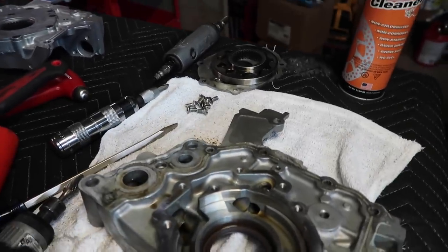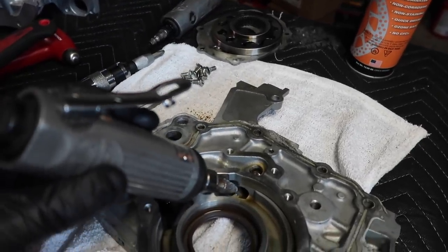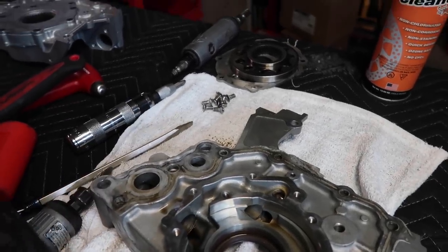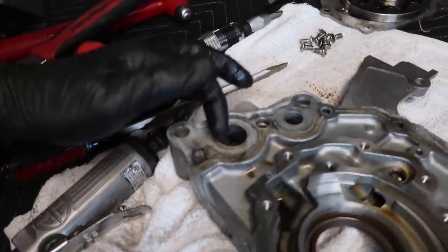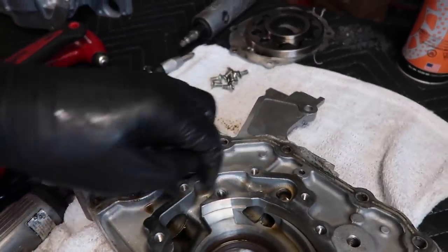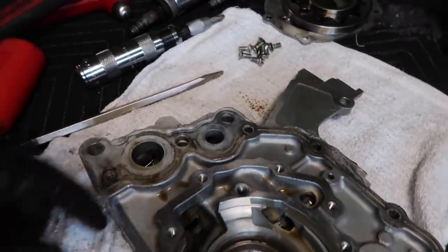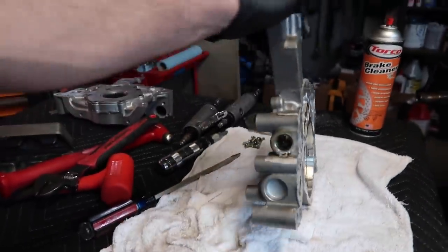I know there's going to be a lot of heat in the motor and I'll be in a hot area when I'm racing, so I still run 20W50. I put my tolerances within spec to what CP and Carrillo are asking for, with a BC crank, and then I port this just to open up the flow where there's a rough edge or an extra piece that needs to be removed. I port right here and right there to open that part up — it's coming in and then going out right here. You want good flow in and on the way out as it builds pressure. This is the relief here to drain back, so if you open that too much it'll screw you — don't do that. Just go one size over; this is what older guys who've been doing this for years taught me.